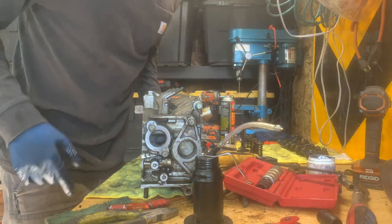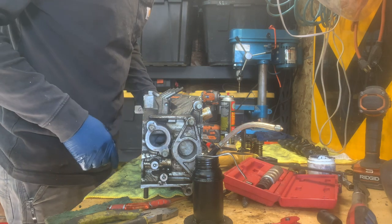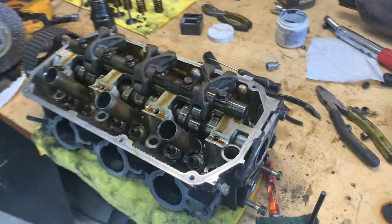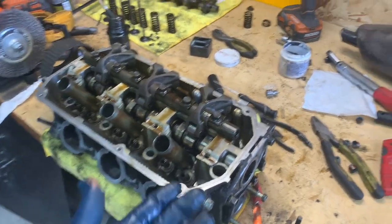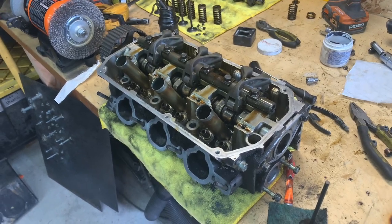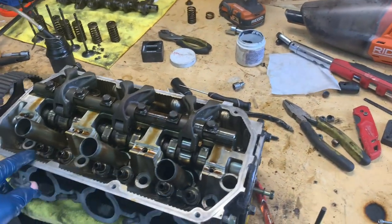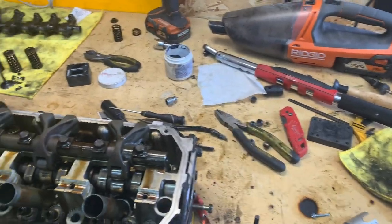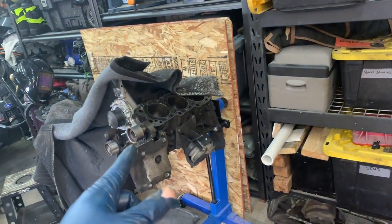I'm going to knock out the rest of these and get done with this job. Anyway, hope that explains how far into the motor these valve stem seals are — there's not really an easy fix other than just getting in there and doing it. If you guys have questions or tips on how to do these, post them below. I'm going to get these pulled off with some pliers, throw some new ones in, and continue on with my Montero Sport engine build. We'll see you on the next one.